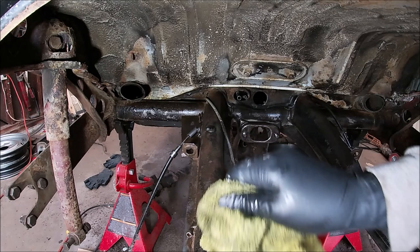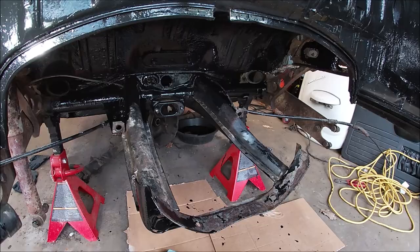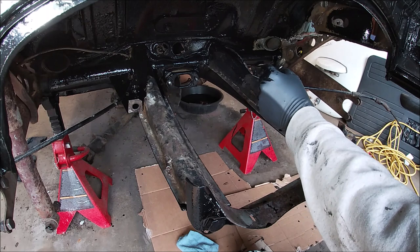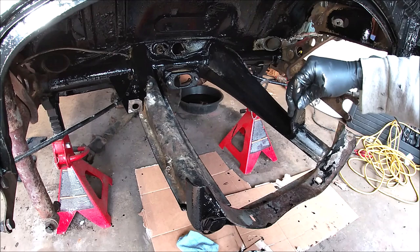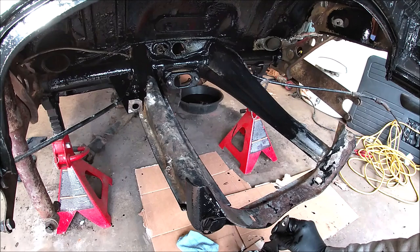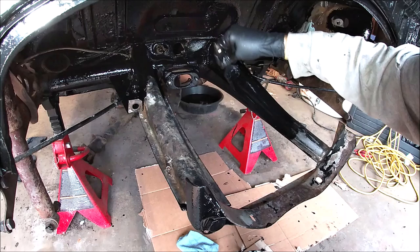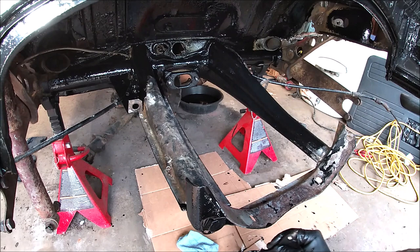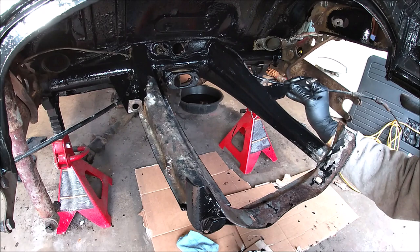Now I've got most of it done because I had to lay on my back and reach up inside. I saved the top part to show you how thick this goes on — this stuff covers like concrete, and it actually dries like concrete, that's the funny part. You should do a second coat — the directions call for it. You've got to get the second coat on within two hours. If you wait past that, you're going to need to scuff it down with like 180 to make it abrasive again, because it ends up like glass — very hard.